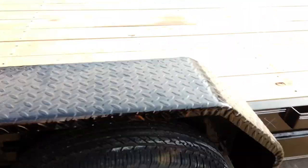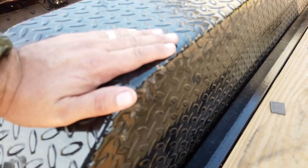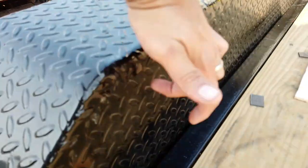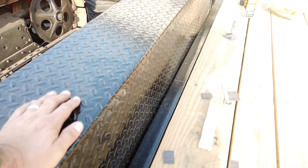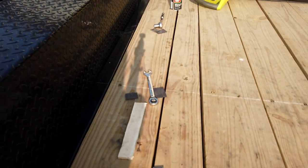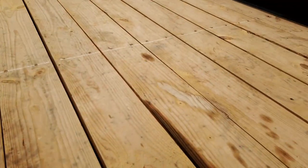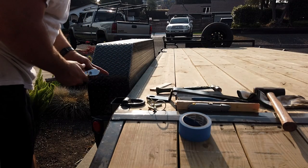And in between the top portion of the fender up here and this back panel, they're two separate pieces. And they're only spot welded about every 12 inches. Well, that gap in between there is actually what's rattling. So I use these door shims, these dark plastic door shims, to put in between here on the back side. And so that's what I'm going to do to this other side right now. So first thing I'm going to do is start out by loosening the bolts of the fender itself.